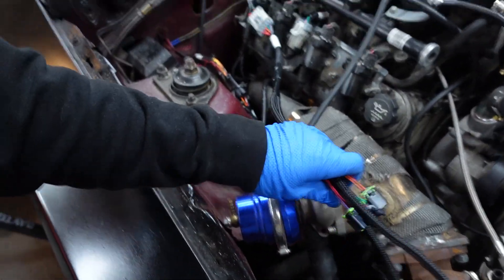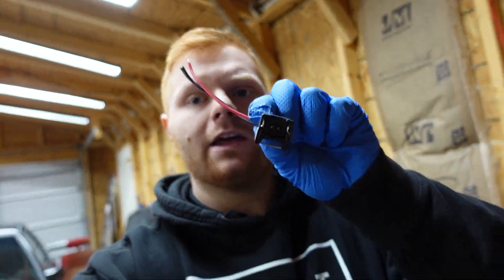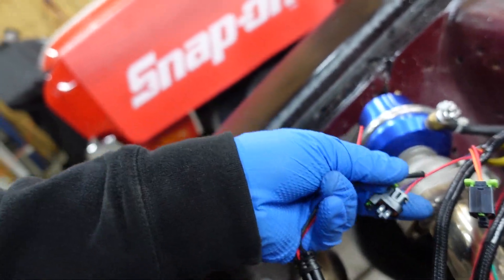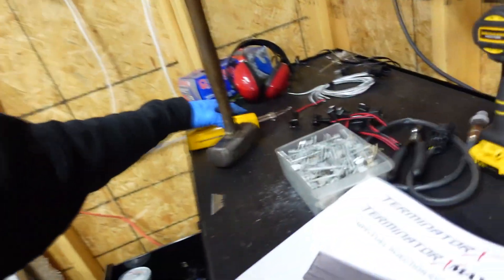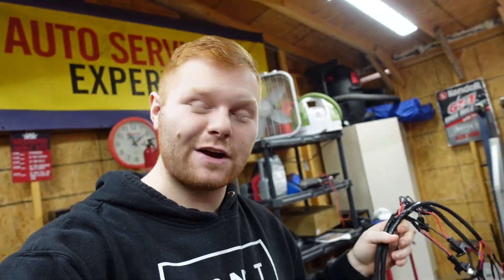Now that I got the harness hooked up for the injectors, I did notice that the red on all of these wires is the ground. I really don't want to spend the extra $100 if I don't have to. So I'm going to take my old ones that I had for the Siemens Deka 80-pound injectors, go ahead and wire these in. Pretty self-explanatory - black is your ground, red is going to be your pulse. Just make sure not to cross these over, so black goes to red. I'm going to get the soldering iron out and make sure these connections are all good and tight. Got the harness all soldered together and then obviously heat shrink. Now all I've got to do is plug and play.